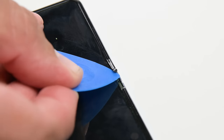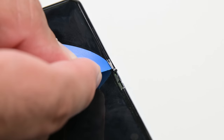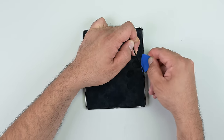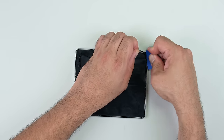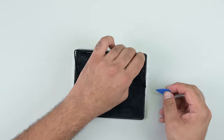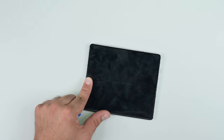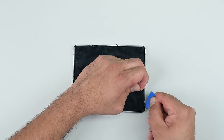Here's the part that's never been DIY-friendly on Samsung foldables: the inner screen bezel. Unlike the Google Pixel bezel, Samsung has again opted for a clipped-in and highly breakable bezel design. It's not fun removing these, but we put our heads together and came up with a system — lift the edge with the sharp end of the tweezers and slide a pick to release a section at a time.